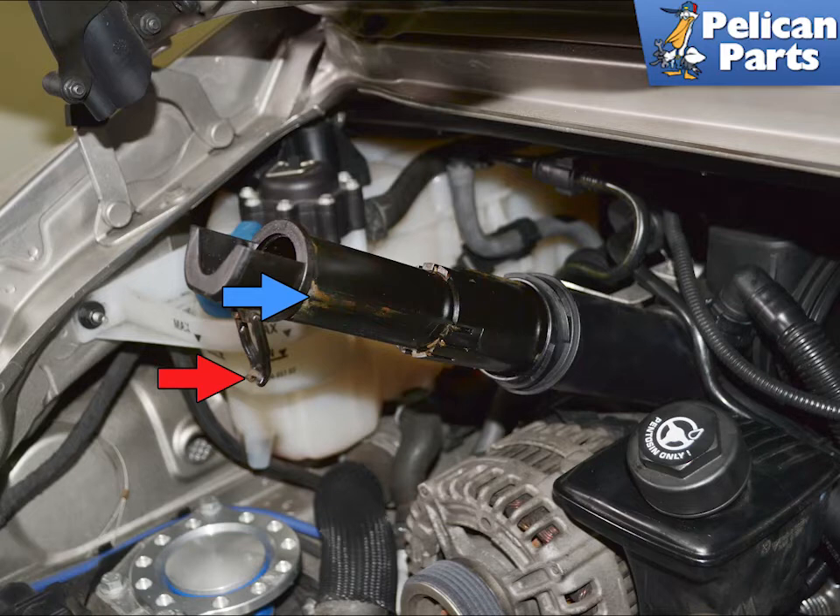The slight browning you see on the neck is a sign of condensation and not getting the oil hot enough. This small amount usually means you are not warming up the engine enough and driving it long enough to burn this off. If you are worried about an oil and coolant mix, check your coolant reservoir and perform an oil change to eliminate any doubt.